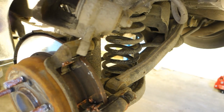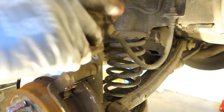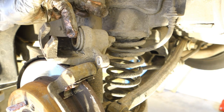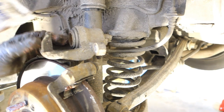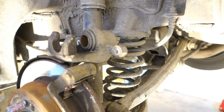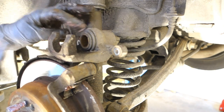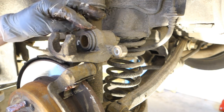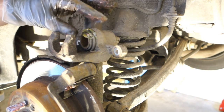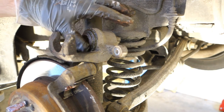There is this interesting thing where we have a lot of issues. This brake caliper, and especially in that area in here. We have issues because this is the piston that moves in here in that way. And normally, when cars become old, it becomes stuck, and then our brakes don't work or they are bad and there is noise. I can insert my brake lubricant in these parts, and also in this plastic sealant, like this one. I add this in there. It is like Vaseline, but it has been designed for these brake parts, and for that area and that shape.